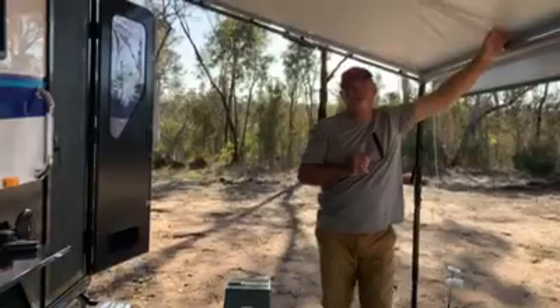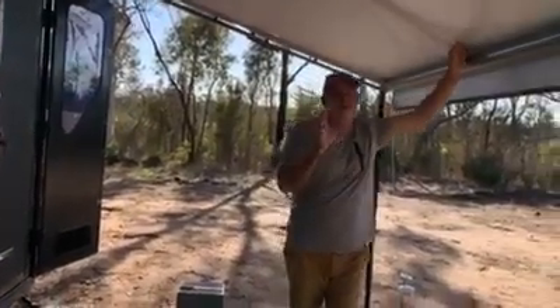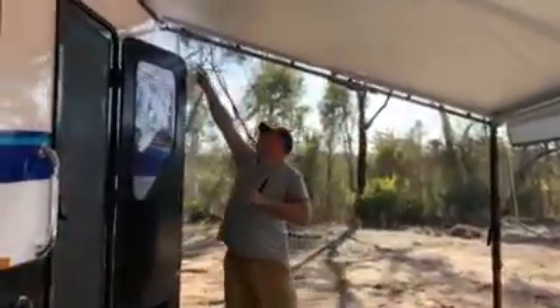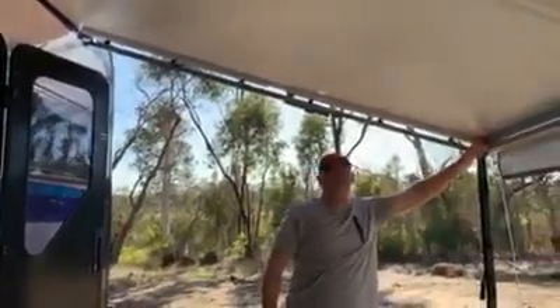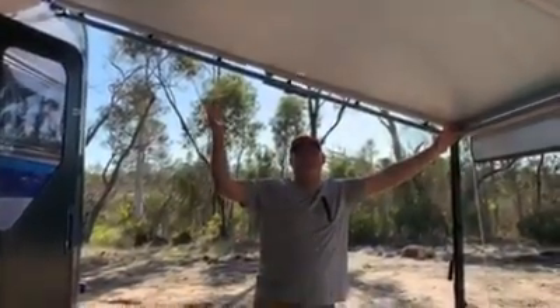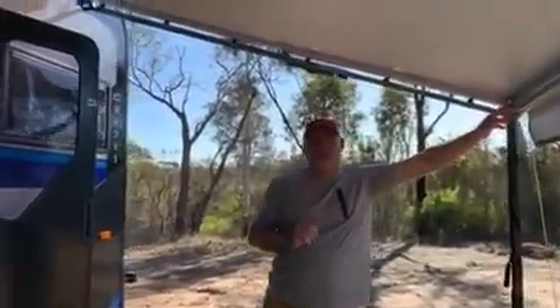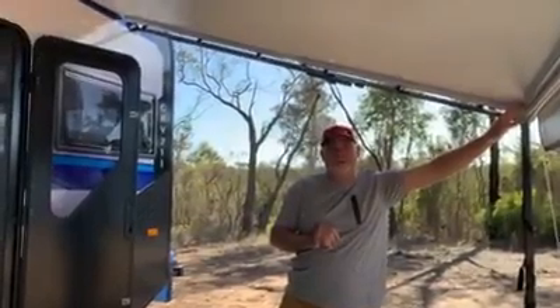Obviously if you've got cyclone winds or very strong winds, you'd probably like to have your awning put away. But for most of the time, this system works well. So if you are going to come into the shop looking for some anti-flap bars, before you come in, what you need to do is measure from the side of the caravan to the awning tube. That measurement — there are 3 different size bars — will tell us whether you need shorts, mediums or longs. Before you come into the shop, just make sure you have a little measure, get the measurement, then we'll know which ones you need. Hopefully this has given you a bit more information and made life a little bit easier for you. Thank you, have a good day.